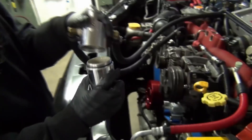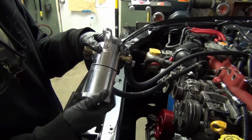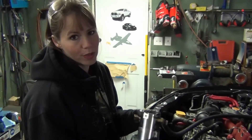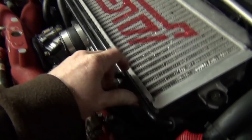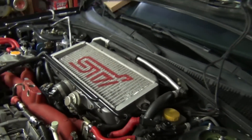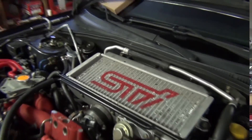Looks like a byproduct of a head gasket failure. So if we didn't have these oil catch cans on there, where would all of that accumulate? That would stay in the intercooler. So we see we've got this plumbing here that carries all of the crud, gives it a place to land or fall into and get caught so it doesn't bugger up the intercooler. We've got another one back over here, so that's more to keep track of.